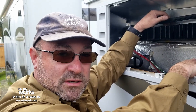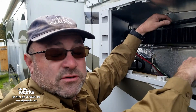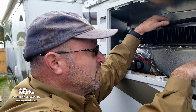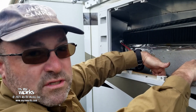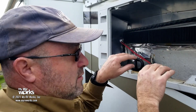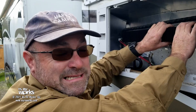Your homework assignment: if your refrigerator is in a slide room, go see if you've got this big void right here. If you do, this is a solution I came up with that every time we've done it works out great — create this little baffle. On these refrigerators you want less than a zero or one-inch gap along the back wall, which this one does have. You want zero clearance on the side walls and zero clearance on the top. This one had a big void on the top and a big void right here, so the air is not coming through the condenser fin — that's the point I'm really trying to stress.